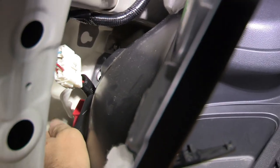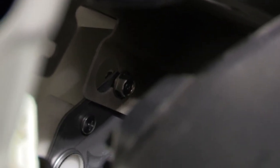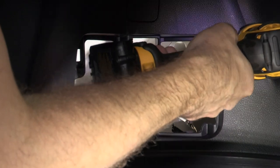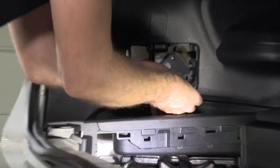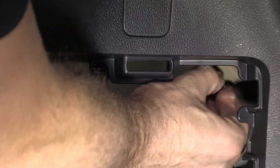The ground wire connection is this white wire with the eyelet on the end. We're going to find a mounting point — it looks like we can use these 10 millimeter bolts already existing on the vehicle. I've got a 10 millimeter socket, I'm going to remove this bolt and place the ground wire eyelet beneath it. I'll start it by hand just to make sure it gets started correctly, then snug it right back up.